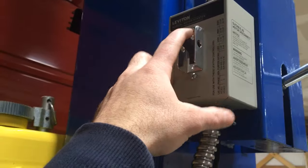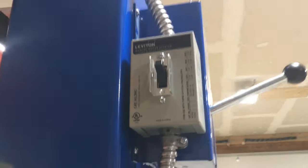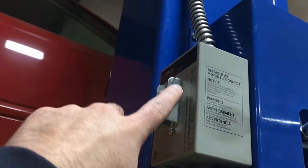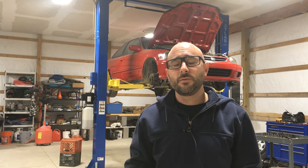This switch is on right now — I'm going to keep it on all the time because I'm really just using it as a cutoff switch. It's there in case this button ever sticks; I can just reach up here quickly and flip that off to kill the motor. The other cool thing about this particular switch box is that if I were sharing this space with somebody else, I can shut my lift off and actually stick a padlock through here so nobody else can use my lift. If you made it this far, thanks for watching. Let me know what you think, give me your questions and comments, and let me know if there's anything else you want to see a video on inside the shop.